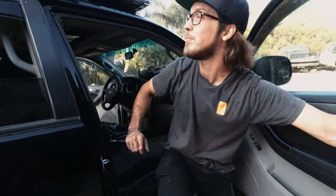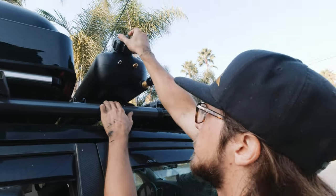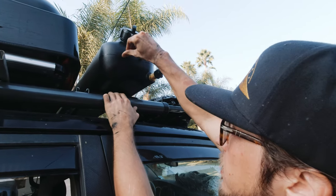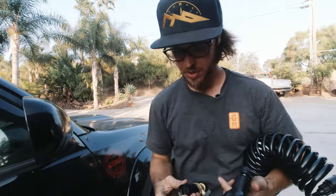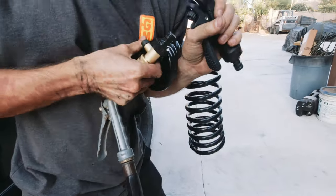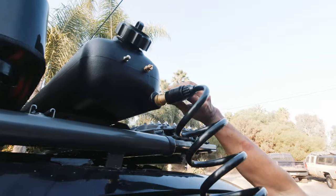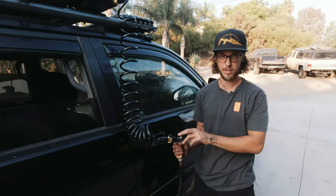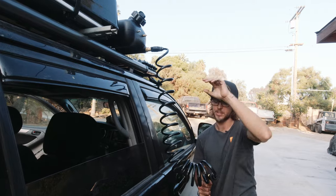There it is — new tank is bolted on. Let's fill it up. Waterports have a couple different ways of filling and pressurizing. You can take the cap off and fill it up with a hose through the top, then pressurize with the optional pump cap if you have it. They also all have a Schrader valve if you have onboard air or a compressor. The way I like to do it is right here with the garden hose — all the pieces are included. Your regulator goes on the hose, then grab your included 16-foot hose and plug it in. The awesome part about filling this way is that it will self-pressurize with the garden hose. This regulator will squirt water out if you start to over-pressurize, so we don't damage the tank. There's also a pressure relief if the tank receives too much pressure — keeps you safe.